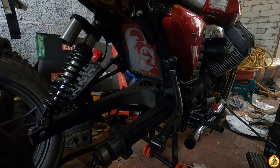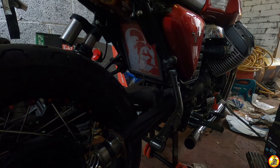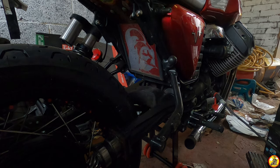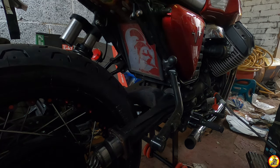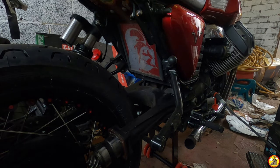Okay, so we have the wheel, which now will just roll in. But I need to put the cushdrive rubbers back in. Now, the six cushdrive rubbers, they only go in one way. I'm just having a little inspect on them. They're okay. I probably should replace them. I mean, the originals, the bikes are 2012, 2013 model. They've not necessarily had an easy life either, doing track days and stuff, but they look in good condition, and I don't think there's too much play in them, so I will maybe change the cushdrive rubbers next time I change a tyre.